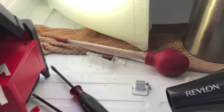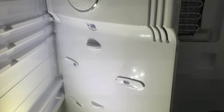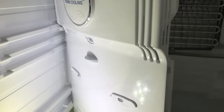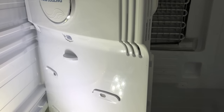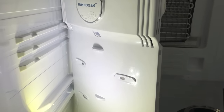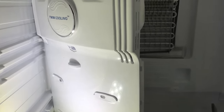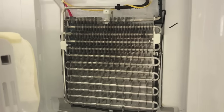I'm using this turkey baster to take hot water — but let me show you the panel first. This is the panel that was removed from the back. There's one screw under a cover and two screws at the bottom. Once you get those screws off, you have to be patient. I used the hair dryer around the perimeter because chances are you'll have ice frozen back there that holds the panel in place. Once that ice melts enough, the panel just pops right off.